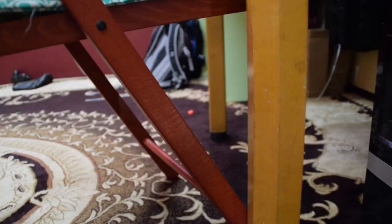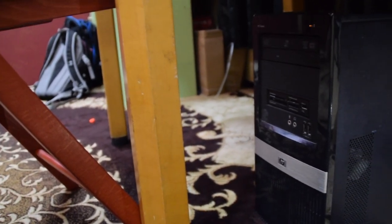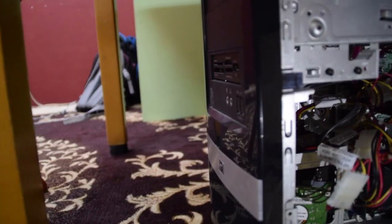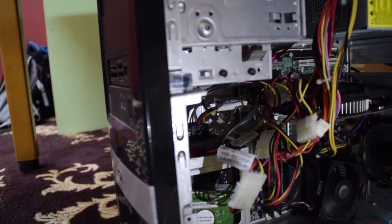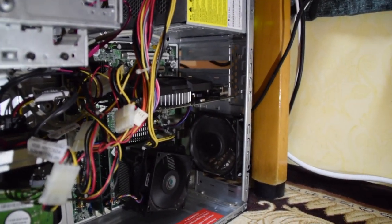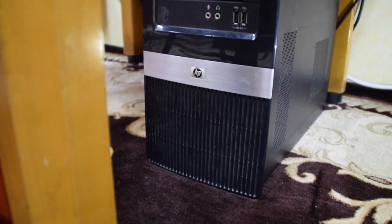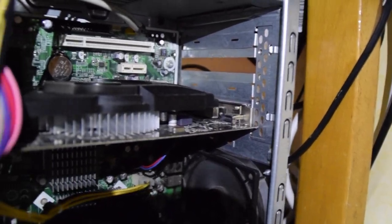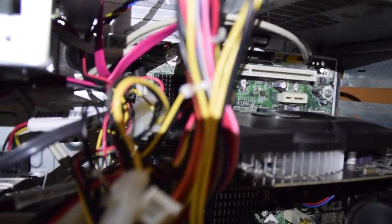Welcome back to Mr. Tech Boss. My dad bought this PC back in 2009 for about $600, and for that time it was a pretty decent mid-budget machine — the Core 2 Duo E7200 and 1GB DDR2 memory, which is pretty low specs by today's standards. But I've upgraded the RAM to 4GB DDR2 and the Xeon E5450, and it's an LGA 771-to-775 mod.